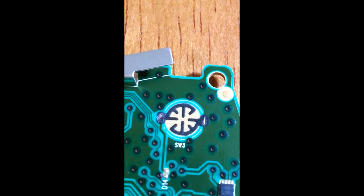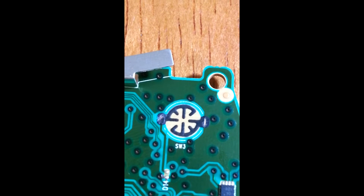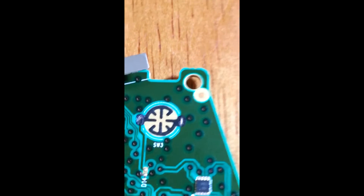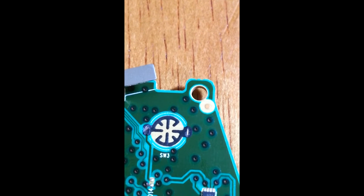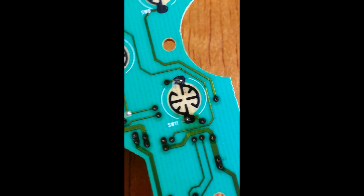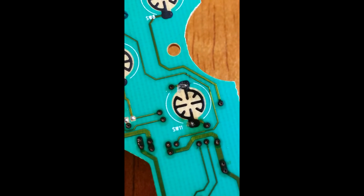Just to show you the scraping, you'll need a little bit. The side on the right is a little bit longer than I meant for it to be, but the one on the left is perfect. You want to avoid cutting off any direct contact, so you just want to do a corner of it. After you get some solder on it — and it doesn't take a lot of solder — that's what it'll look like: just a little bit of solder on it. Next, I'm going to put the wire onto it.